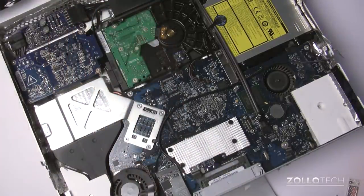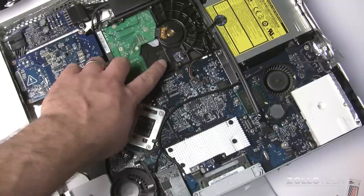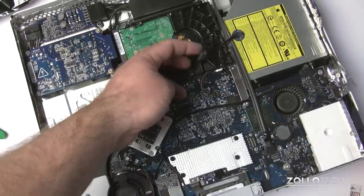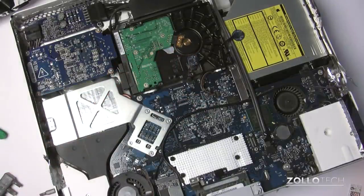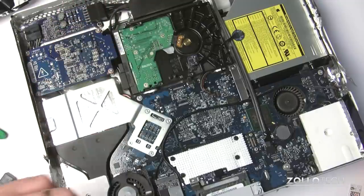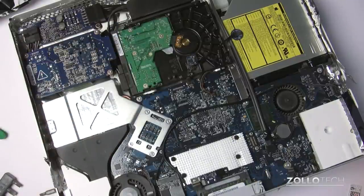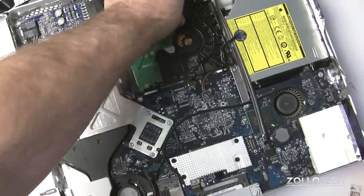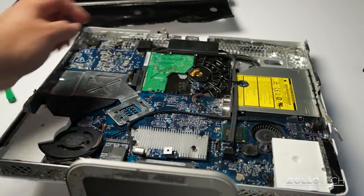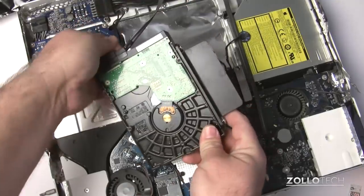Now we have the display out of the way and what we need to do is remove the hard drive. You need to note that there's actually a temperature sensor on some of these hard drives like this one. We need to gently pry this up and place it on our new hard drive. I've removed the temperature sensor that I'll carry over. We can remove the hard drive without any screws by pulling on this lever here — pull towards me, it lifts up and snaps out of place. Then we'll undo the power and the SATA cable.